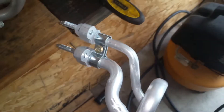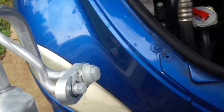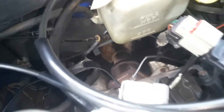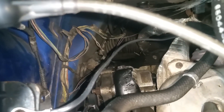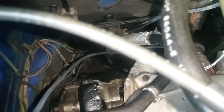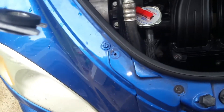I've got a new dryer — you'll need to take this old pressure switch off and put it on your new one, as it didn't come with it. I'm getting ready to set the dryer back into place and get it down in here before I remove that tape and the plugs, just to minimize any extra moisture getting in. I worked it right down through here just like I took the old one out. There's a bolt down there where it has to bolt — I'm not sure what size that is but I'll need to loosen it because it goes right through there.